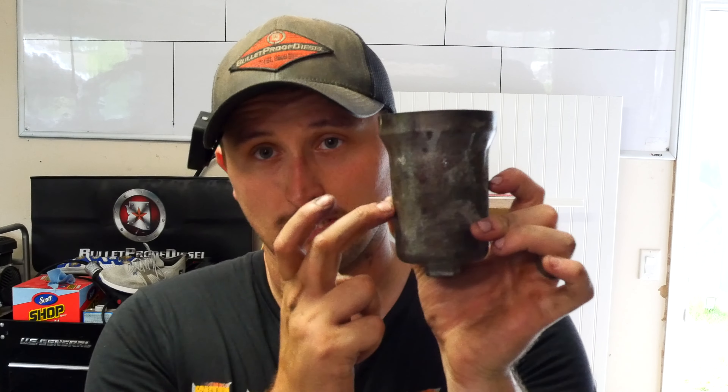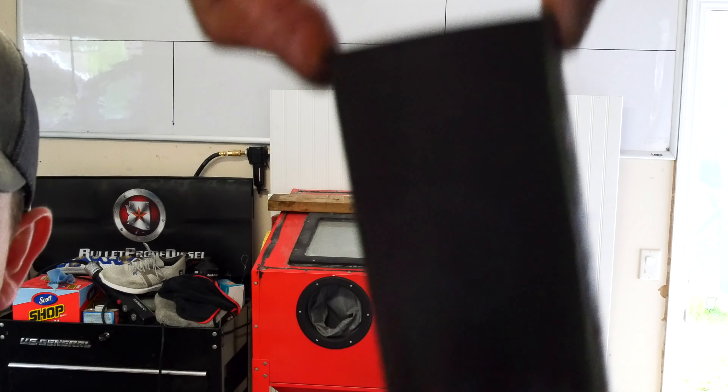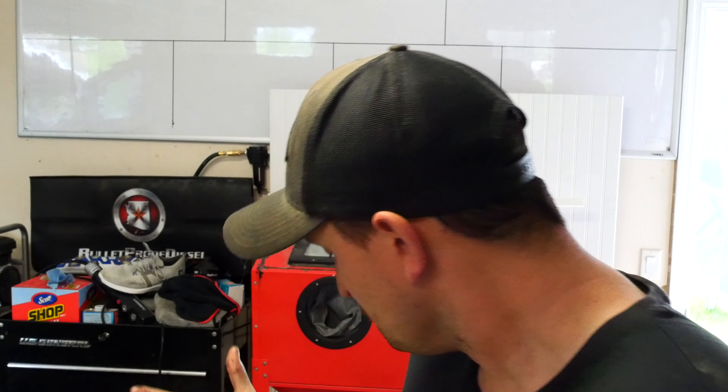Underneath the passenger side of the front bumper, there's this — your transmission in-line filter, what everybody calls the toilet paper filter. It is not supposed to look like that. That is black. I do not know when the last time this was changed, because when I bought this truck it had new fluid. The buddy I bought it from got it from a dealer and never did the trans. I'm assuming all they did was pull the drain plug and put new fluid in just to make it look good. It is not supposed to look like that — it's supposed to be red and clean like the new one.